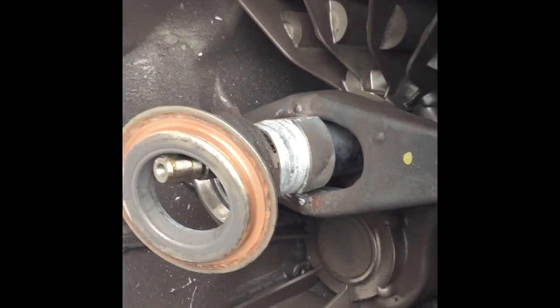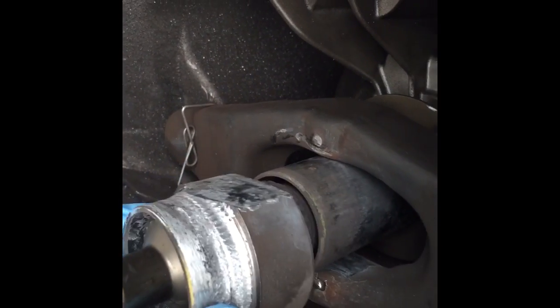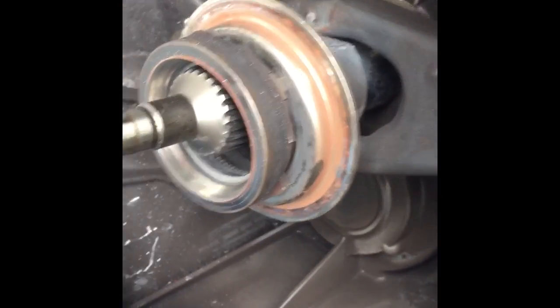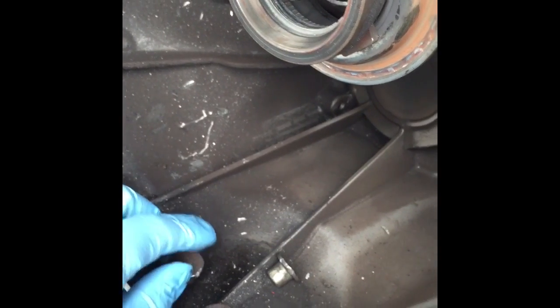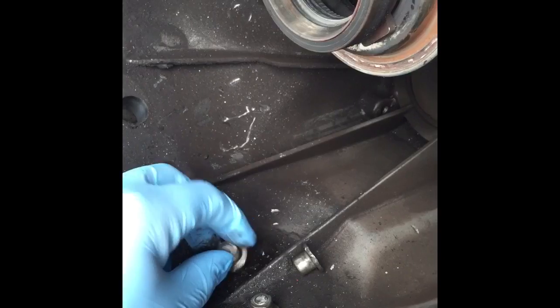This particular one also has the release bearing — this should all be one piece, this release bearing. The only damage we can see, apart from the clutch and flywheel which took a little bit of damage, is that the clutch pressure plate had lost three rivet heads — they'd been ripped off and had been going around the gearbox, making some dents, but don't appear to have caused any actual damage. Some of these had also hit the flywheel crank sensor teeth and made a little bit of a mess.